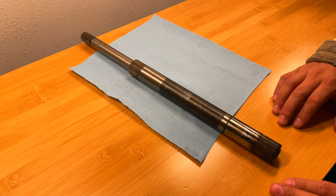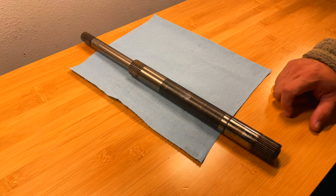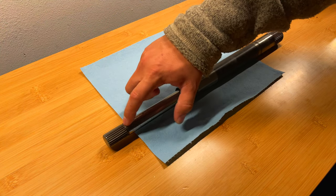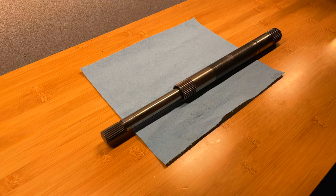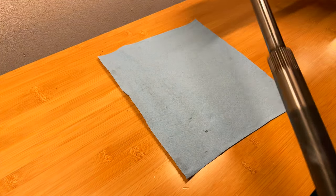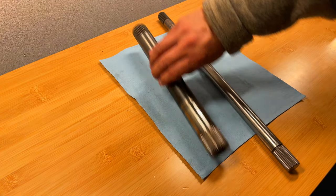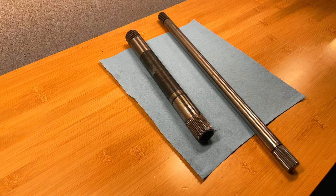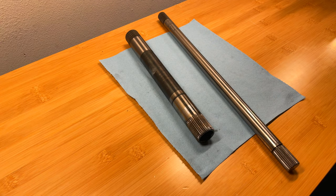This is the two-piece input shaft on these AODs. From what I've read and heard from a couple of shops, anytime you throw a lot of horsepower — you stroke your motor to a 347 and still have an AOD — these tend to break. I've seen on the internet that this front part of the shaft will break off with a high stall converter or a decent amount of horsepower, and by decent I'm guessing 400 to 500 horsepower on up. So please make sure to take a look at your input shafts, because these will break when you throw too much torque at them. These are not hardened — these are factory pieces.